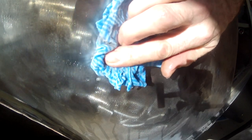I also use a shrinking disc on my grinder, which is basically a big stainless steel plate that you put onto the surface with an angle grinder, and it heats up just certain high spots. That was really effective as well, and it doesn't leave gouge marks or anything like that. So a shrinking disc is a really good thing to have, but they're quite expensive.